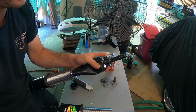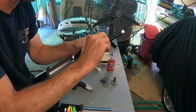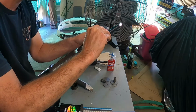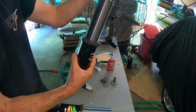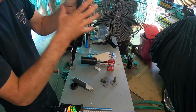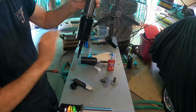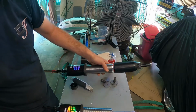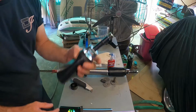Let's get our little Allen key. Do him up. We'll just adjust our shock. We'll go all the way down, and we'll get a measure as well. So that's down. Just crack it off. And just before we go in, we're going to give it a measure and check our heights, make sure they're the same. They should be. And we do it all again on the next one.